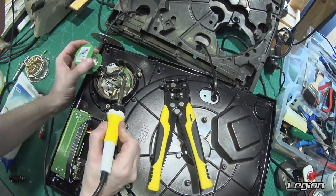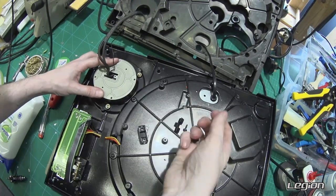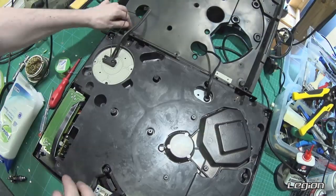I had one where the blue wire's shielding had broken a little bit, so I just stripped that back. You can also just use the soldering iron and heat up the shielding, which will make it shrink to expose some of the wire.